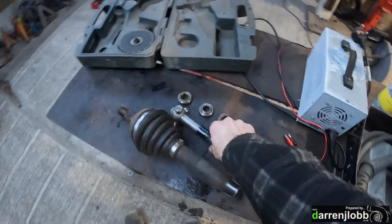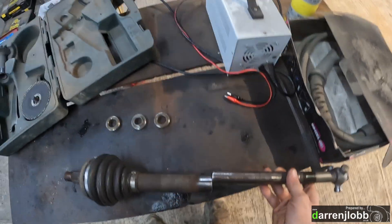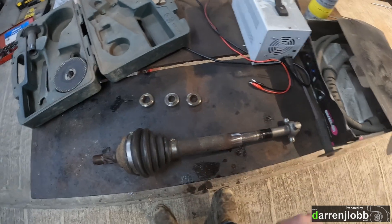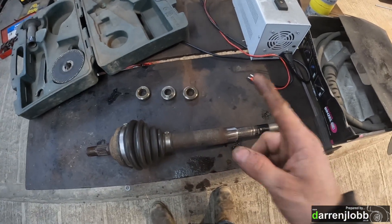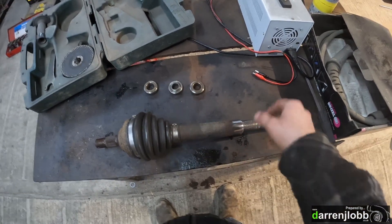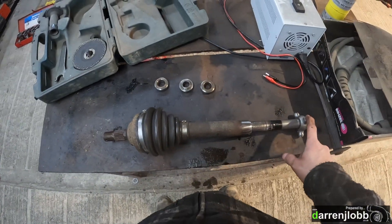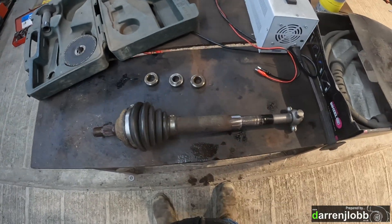It's quite convenient - the Honda one is solid and the Peugeot one isn't. So we can actually slide it in, fit it to the car, get the length we're happy with, mark it, and then take it out and I'm just going to tack weld it around the outside. Then I can strip this CV joint down, knock the joint off the end, and then I've got the shaft that I need replicated.